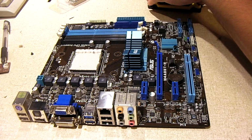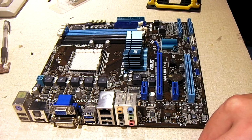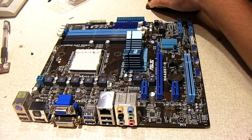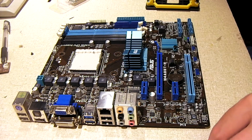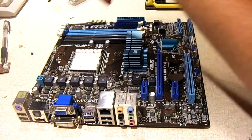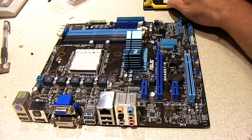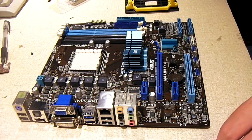It really does make me kind of question it in a way. Like maybe someone had a high-end CPU cooler on this thing, or they may have used this thing for overclocking, had it water cooled, I don't know. Because usually in the case where you have a really high-end cooler that mounts directly to the back plate, or if you have a CPU water block that does the same, would be generally the reasons why you would have to take the original bracket off.